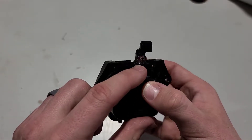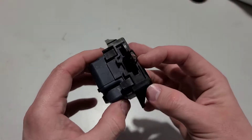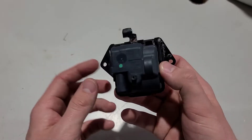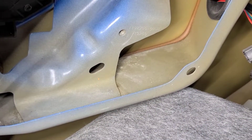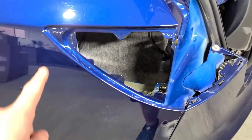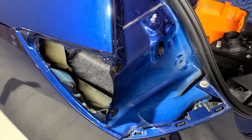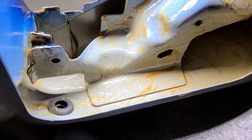We did put the red and tacky grease here because that's what we thought the problem was, but we might have been too late — it just started to get worse, so I had to replace the entire unit. All that right there is salt coming from the charge port. I do live in Chicago and that could also be an issue. A quick fix is we pretty much coated the outer edges and the inside of this Model 3 with Corrosion X so that there's no salt.